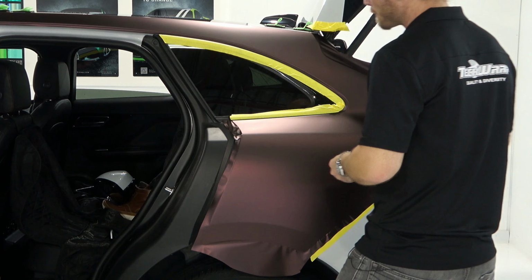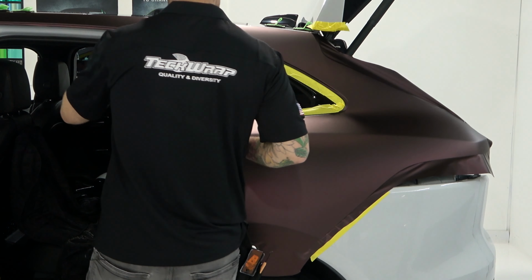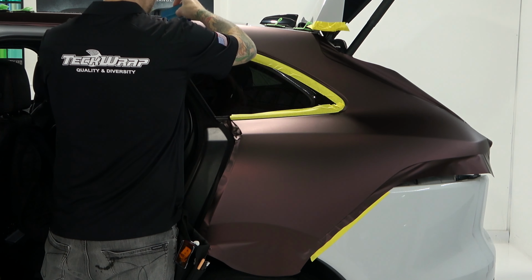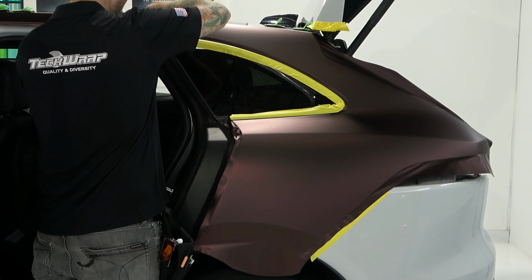It's getting tighter as we go closer to the back. It's super common actually, but it's tucking in also really nicely. If we leave too much vinyl, it gets extremely hard to tuck in. Just another thing to keep in mind. So we don't want to leave too much vinyl because that will also make things very hard to do. We're going to start coming around the top now. It's beneficial to come in this way also. This way we can meet at the corner. So we're going to start tucking that in. And again, this top seal lifts easier. That's what I noticed when I was testing it.